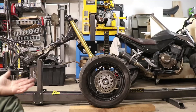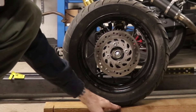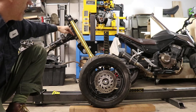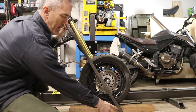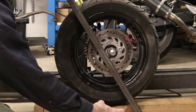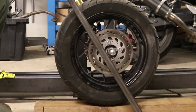From my reading I've come to realize that rake is only important in relation to trail — trail is what's really important in terms of the handling of the bike. Trail is basically this: where the tire contacts the road there's a contact patch. You also have an imaginary line that runs down from the head tube through the wheel approximately, comes straight down and hits the ground back there. From where that imaginary line hits the ground, you measure back to where the tire actually hits the ground — that distance is your trail.